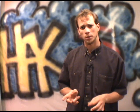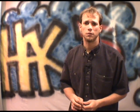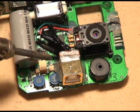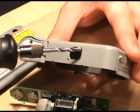Now that you have it open, find a place that's going to be convenient for you to mount the USB female connector. From there, you just follow the pin-out diagram on the connector and solder accordingly to those proprietary pins. Now that you have all your connections made and your plug is mounted, just figure out where it's going to be on the case, draw a little marker on it, use your Dremel, and cut out a hole so that it's nice and tucked away, doesn't look bad, and you've got easy access.